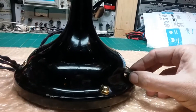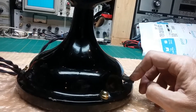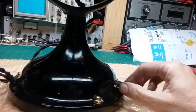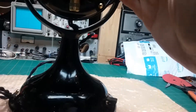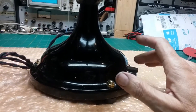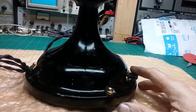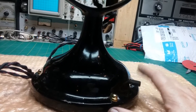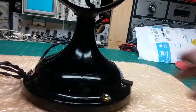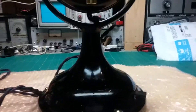You can't ground it to the chassis, but what I did was — the speed control lever has a good insulator on it — so I ran the hot wire there and ran neutral directly to the motor. That way when it's off, there's no power going into the motor at all. The hot line is dead right at the switch, so the whole unit is totally disconnected from the power line, because the only thing connected is neutral, which is ground — no current flow.